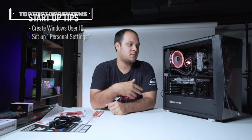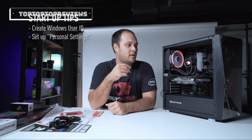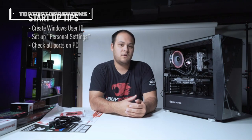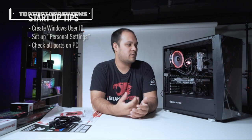So there's a few things that we do recommend you do when you first get the machine started up. Of course, you're gonna have to go through and create your Windows user ID and set up some of your personal settings. But after that, there's a couple of things we definitely recommend. First off, we recommend you check all the ports on the PC. That includes the front panel USB, front panel audio, and all the USB and connections on the rear panel, and as many of the display ports on your graphics card as you can. This will make sure that in the future, if you do need to expand and add anything, you don't suddenly run into a dead port or something that was loose or disconnected. Just wanna make sure everything's working right on day one.